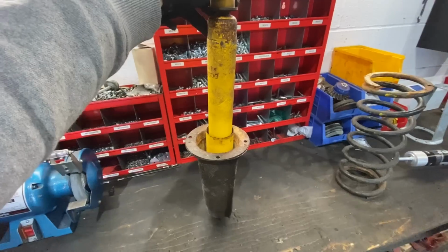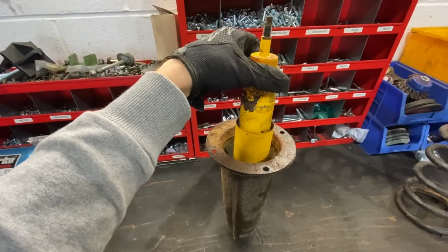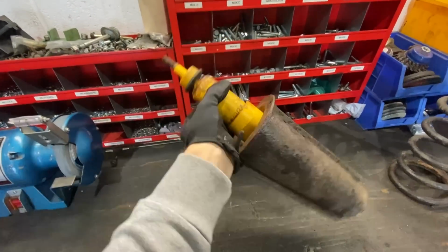And I think that's a combination of the springs. Obviously the shocks are actually working. As you probably saw in the previous video I did, the previous shocks compressed and took about 20 minutes to come back out, so they definitely weren't helping with the ride at all. But I think one of the biggest things that made a difference is the anti-roll bar, because that holds the whole body and chassis together in a much more rigid way. So high-speed driving and going on longer distances has become way, way easier.